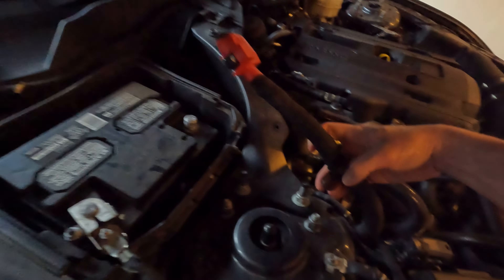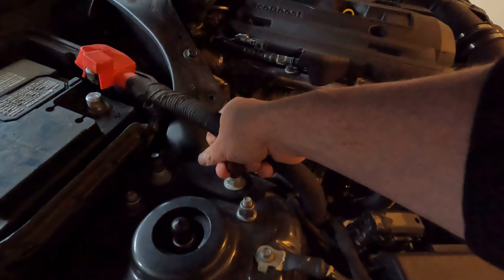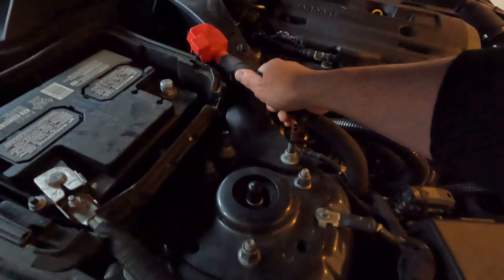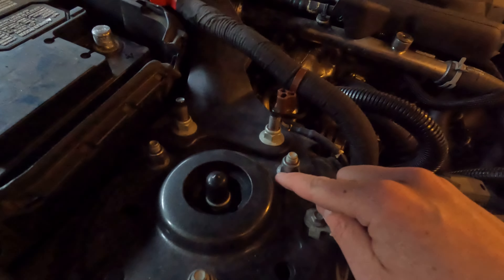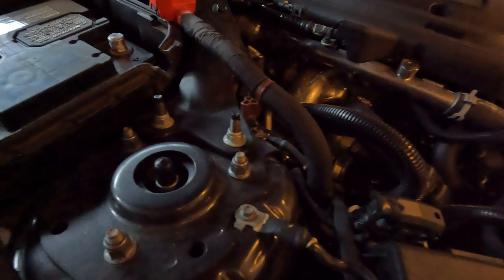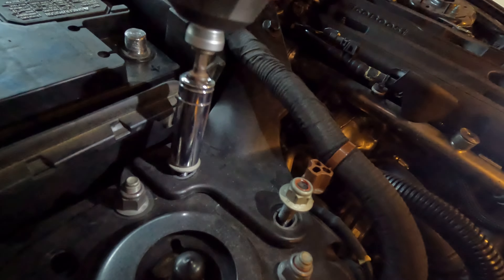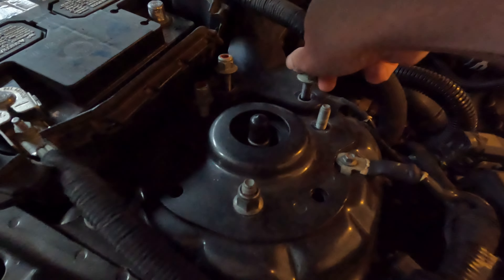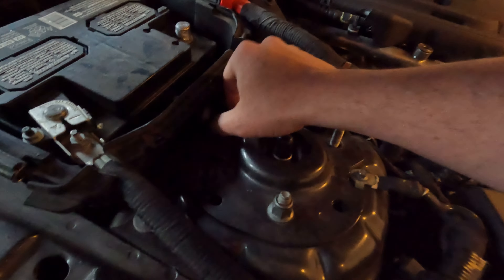All right, we removed the cable. Then you're going to want to pull this little pin off here that's located on the top stud — give it a tug and pull that off, careful not to break this. Then I'm just going to lay that off to the side and we're going to look at these nuts. Four 15 millimeter nuts coming off right now. All right, those are all loosened up. I'm going to remove these and then we'll go on to the other side.